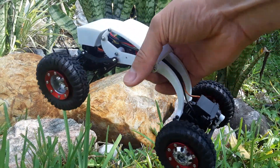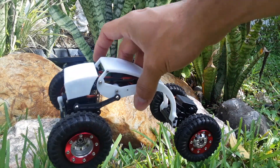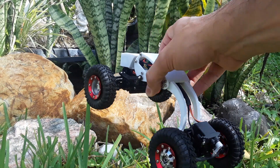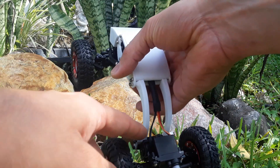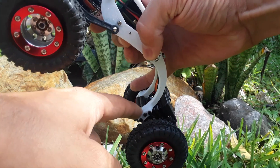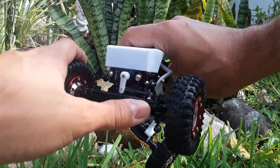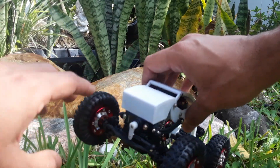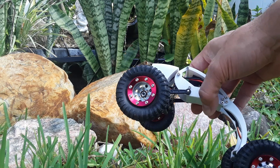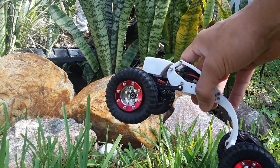We're going to test the V4 version of the Stingray chassis. I made it with a 6-inch wheelbase to mimic what I was doing with the other one. This version does not allow for articulation on the back — it's a hard set right there on the axle. That makes for a really clean look, but it limits full articulation of everything else. You get about 45 degrees of articulation just from the front axle, which in some situations is all right.